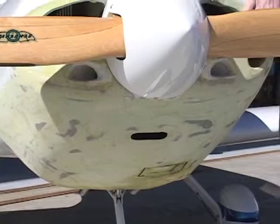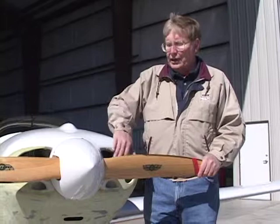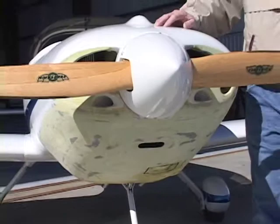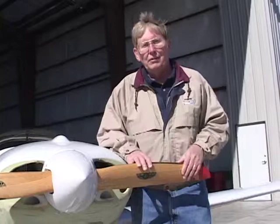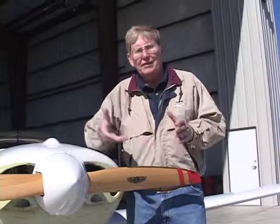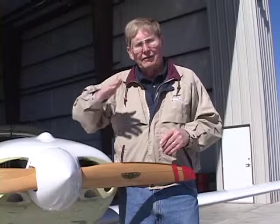I've had to rebuild the cowl to accommodate the new engine and I'm also redoing the front for all the air intakes. The Jabiru engine is a four-cylinder air-cooled engine, so you have to have an air induction system to force-cool those cylinders. The cowl is basically all freehand — once I had the engine positioned where I wanted it, I started taking blue foam from the lumber yard, cutting it up and gluing it underneath, forming a new cowl. Once I had all the foam in there I sanded it down and smoothed it out, then started laying up glass on top of that — like a paper mache — building up four layers of glass to make the design for the new cowling.